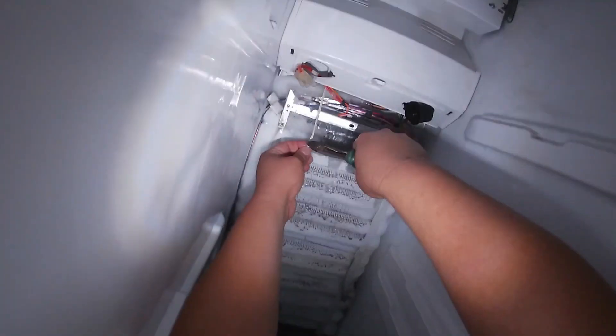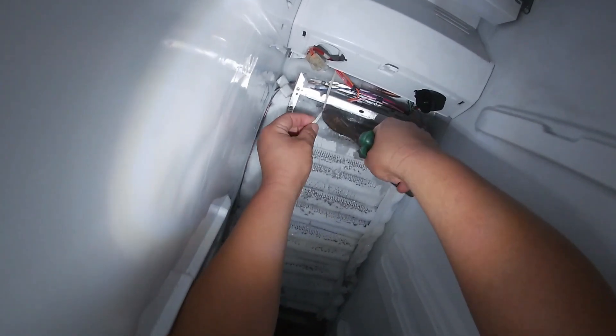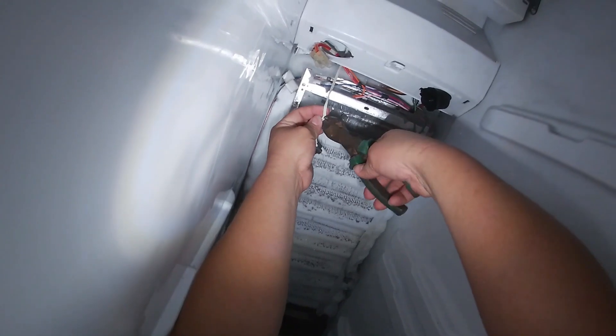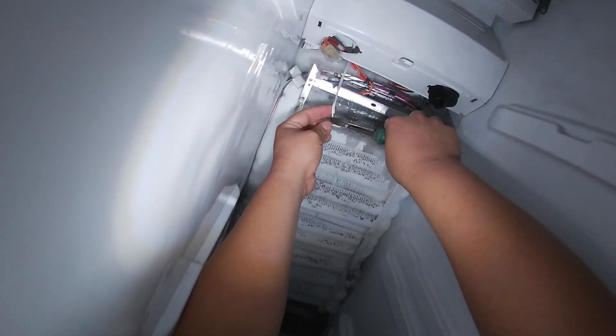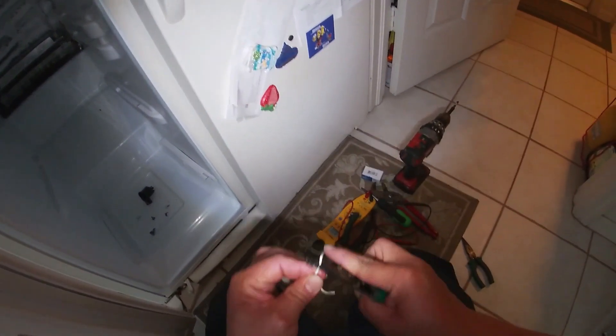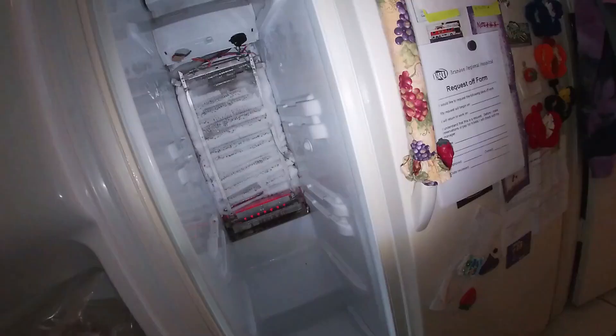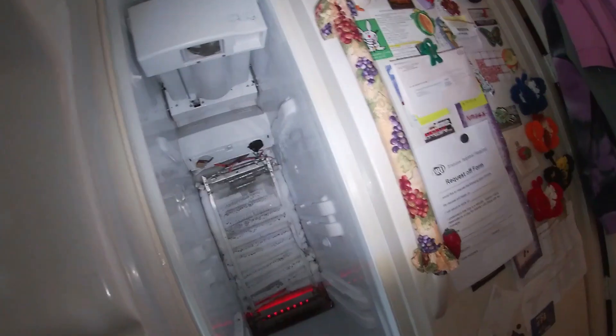However, if you have the coils freezing up but the temperature on the front panel is fine, go ahead and replace the kit like I show in the other video at the link. Now we're going to remove this thermistor and test it because this is one of the most common things when you have freezing-up coils. As I was doing this, the refrigerator went into defrost mode and you can actually see the heat element lighting up to defrost the coils.